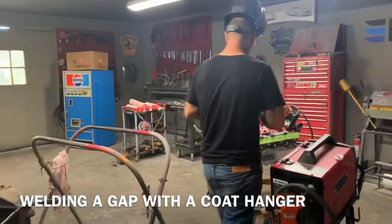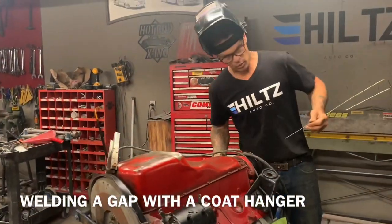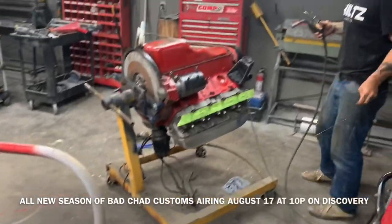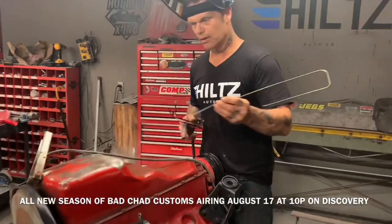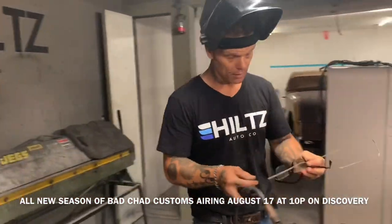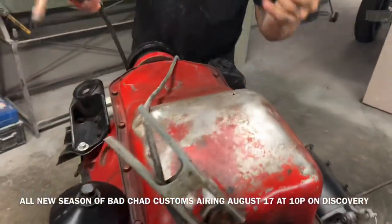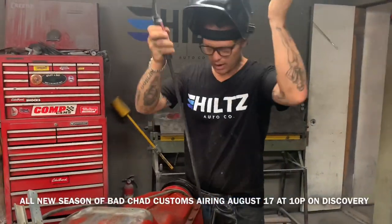I'm gonna make a little video just because some of the little tricks I do you might want to know and know how to do yourself. What I've got here is the 322 nail head for the coupe. This is the engine for it and I've got a pinhole in the oil pan. I noticed it dripping here and there and I wire wheeled it off. I don't have the oil pan gasket for it and I don't think there's anything wrong with it. So what I'm going to do is take this little coat hanger, put it in that hole and fill that hole. Just little tricks of the trade.